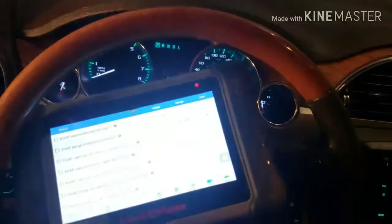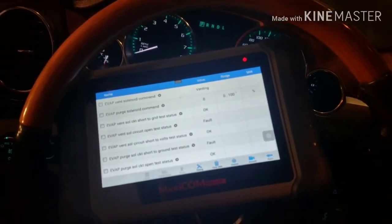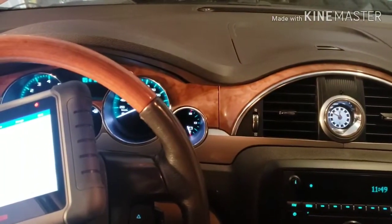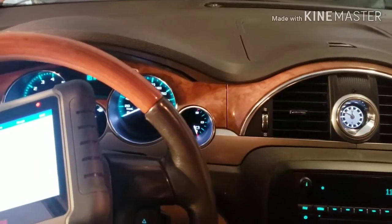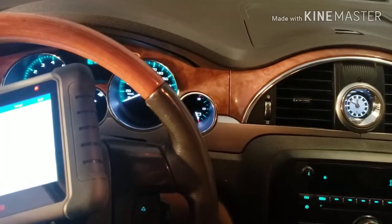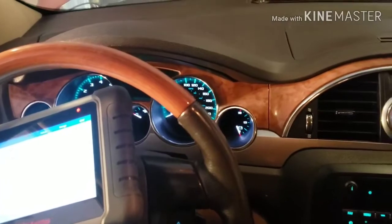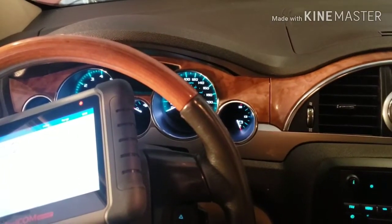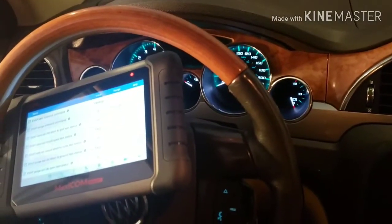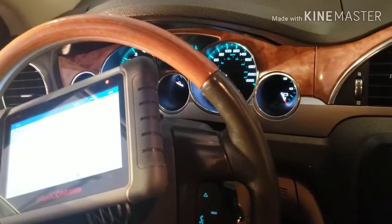So how the system works on the vent is when the engine is off, the vent valve is open automatically. Open. When you buy this vent over the counter at the parts store, it's always open. When you apply voltage, it will close. So when you get out, turn off the engine, you put gas in, the vent valve is open. So when you put liquid in the tank, you have to have that air out. So it would replace the air from the liquid. So that's why the vent valve has to be open so that it will breathe.